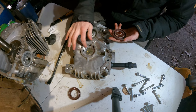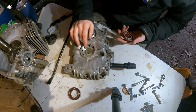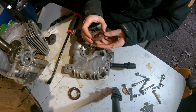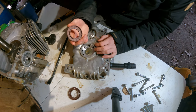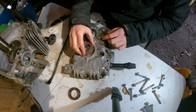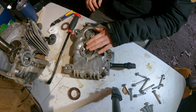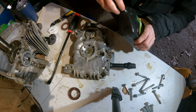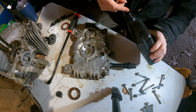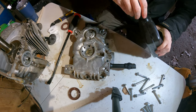I got this cleaned up — just wiped it out with a paper towel. I made sure there were no sharp edges or burrs left from when I was prying on it. It has a nice big chamfer on it, so thankfully they thought ahead on that. The new part actually comes with that spring already installed, so all we need to do is press this new one in. I'm going to use a little bit of oil — that old one went in really tight, so I think I'll need a little help driving this in. I'm going to apply a very small amount of oil to gently lubricate the inside of that sealing surface.